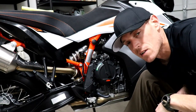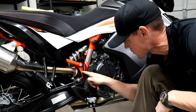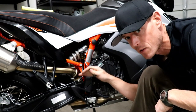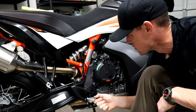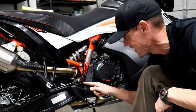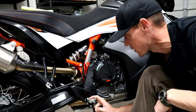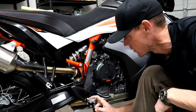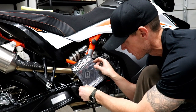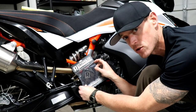One issue with this area is that the rear brake master cylinder line is just exposed right next to where you're coming down and whacking it with motocross boots. People have been kicking this off and losing their rear brake — all the fluid goes bye-bye. You can technically ride home without a rear brake, but it's still super annoying to deal with. Rottweiler Performance has a guard that's not only going to protect it but help keep it in place.